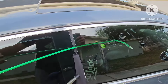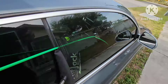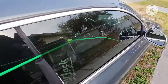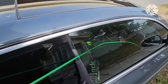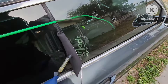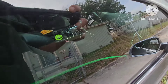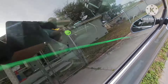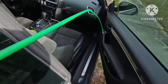Pretty simple and easy. It won't hurt the window or the glass. And then just come over here to your door handle. Hook your door handle. And when you do that, you're going to want to put your hand behind here so you don't chip this glass. And just kind of rotate it like so. Get behind the lock — like that. Pull it. And boom — unlocked.